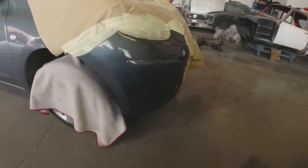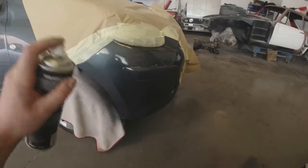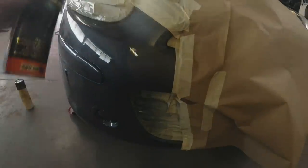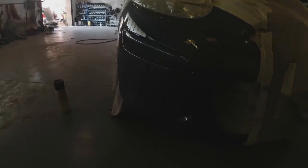Final wet coat - I'm going to want both hands for this, so I will show you the end result. Basically all we're going to do is go slower and lay more lacquer on, but obviously being careful not to go so slow that it's going to run. We've got a fade-out thinner here - we're going to put a little bit of that where the lacquer ended each side, just dust that on. So just dust that on.